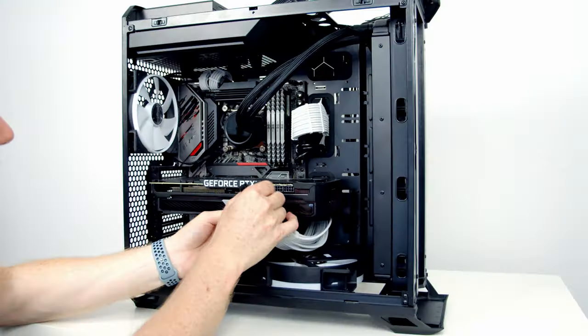Taking a look at the same thing again, but this time with three 140mm fans at the bottom. This time CPU temperatures were actually higher with the rear exhaust fan by 1 degree at idle and 2 degrees under load. There was no difference to the GPU temperatures, and again the rear exhaust fan was associated with 2 decibels of extra noise at idle. So this explains Fractal's decision to ship the case without a rear exhaust fan, because adding one in its default configuration with 140mm fans at the bottom actually makes the noise levels and the temperatures worse. Even with the 180mm fans at the bottom, you're only saving very slightly in terms of temperatures. That is going to be offset by an increase in noise levels. Plus, you're going to have to spend money on a fan. So my advice to you would be to leave the rear fan location empty.